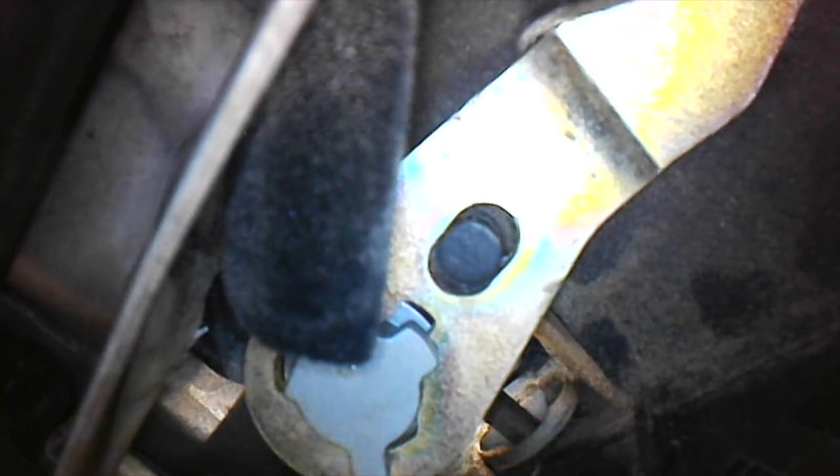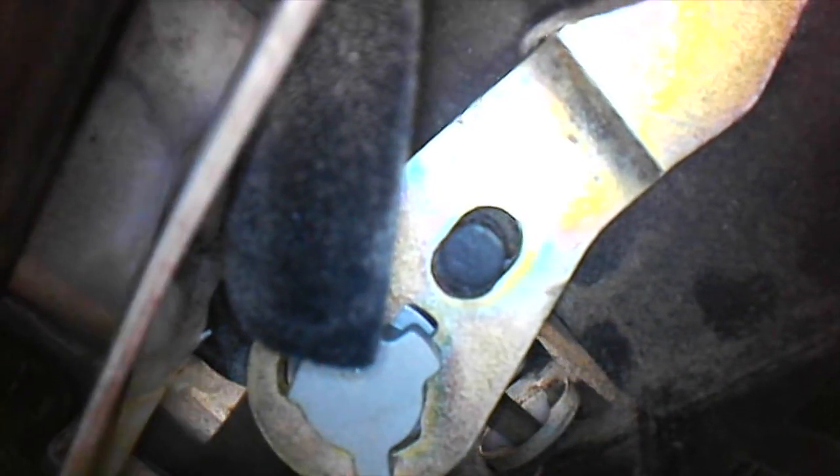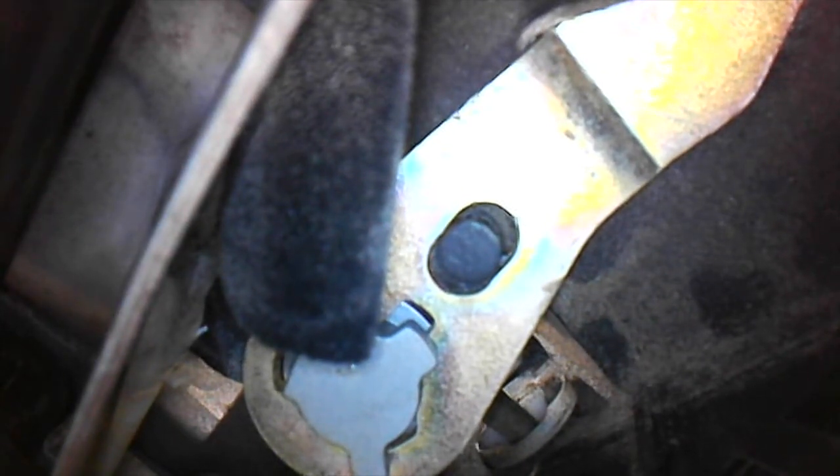We're going to go inside the door here, and this is me fixing this on my car. In my case, my rod needed to be pushed inwards to reach the hole. You may need to go up or down — it's going to take some trial and error. It's a little difficult to do blind, but if you have a camera like mine it makes it easy. If you don't, you can still do it — just move it up, down, in and around until you find a spot that works.